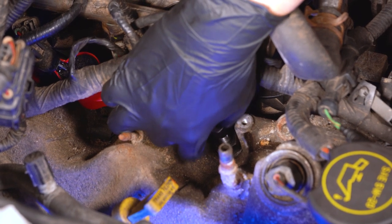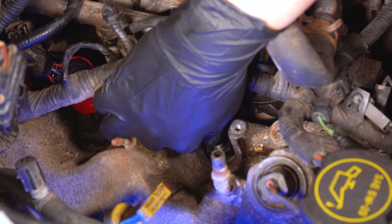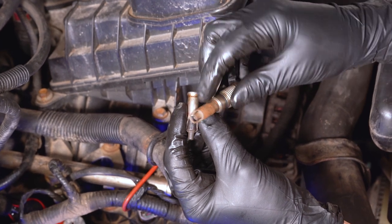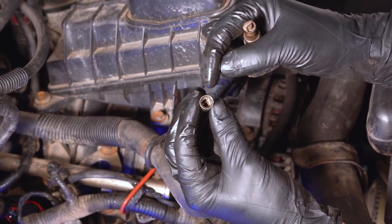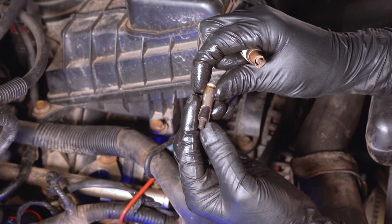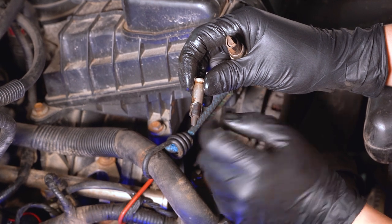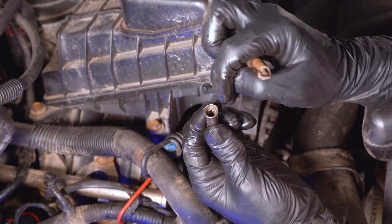I'll show you what this does — it's pretty cool actually. Just as a warning, it'll make some very strange and scary noises, because it's actually breaking that ceramic and pushing it down. Here's the piece of the spark plug that I pulled out earlier — this is what it originally should look like, with the ground strap as one solid unit at the bottom. The plunger goes in the middle of this and pushes the ceramic down, splits the ground strap, and makes space at the top so you can grab it and pull it up later. The scary noises include not just the metal splitting but also the ceramic cracking — you'll have some ceramic particles crack as you apply pressure.